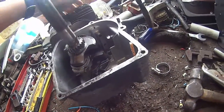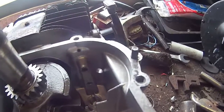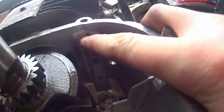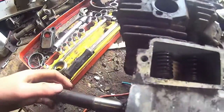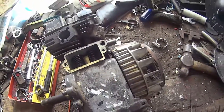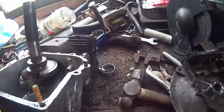Okay, a new crank - if it throws, it throws. It's a little bit thrashed but it shouldn't be too bad. Now that I look into this, you can see you've got the big hole down there, very big hole. And you've got a small drain hole right here, so I'm not sure how to handle the crankcase ventilation so all the oil doesn't get thrown around. I was then thinking about oil slingers.